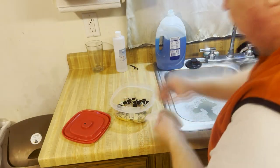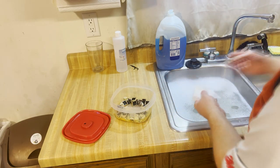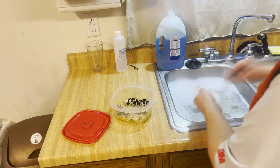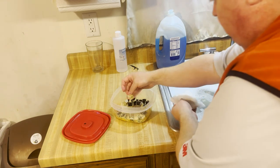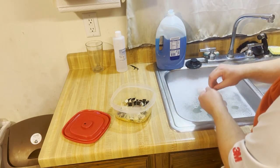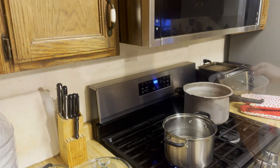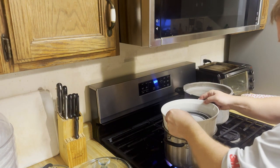Next comes cleaning these keys, and this time I just used soap and water to clean these keys. I don't want to risk the damage that I did with alcohol. These actually cleaned up pretty good. They're just a little yellowed. But then that's where we're gonna try to do the retrobrighting next. I didn't actually retrobrite the top row keys, just these.